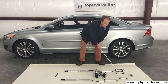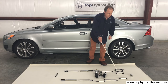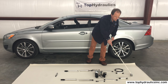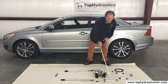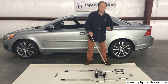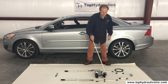Starting in the rear, we have the two boot lid or trunk lid cylinders that flip the trunk lid backwards. We have a distributor here that gets fluid supplied from the pump to the distributor, and from the distributor then to various cylinders. The cover cylinders extend the plastic storage cover for the convertible top — some people also call them tonneau cover cylinders — one on each side.